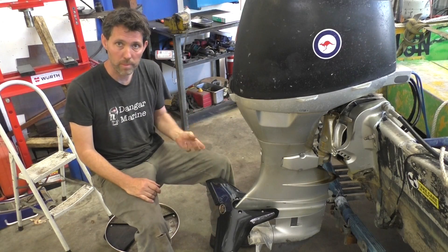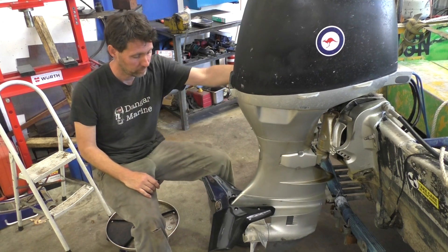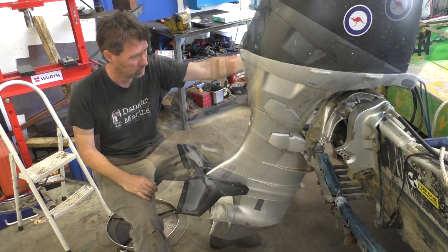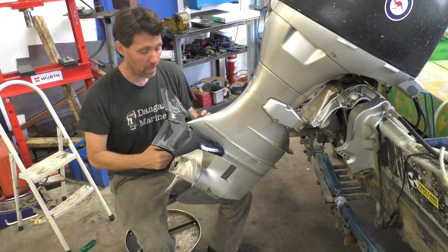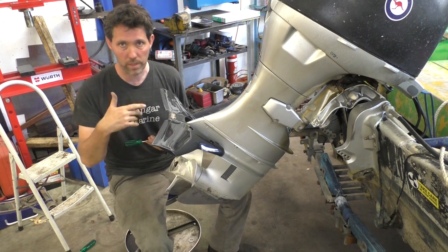Now I'm just going to trim the motor up to make it easier to get to the Phillips heads on the bolts from underneath. No huge trick to tighten them up, other than tighten them in a bit of a star pattern and don't over-tighten them — just let the nylocks do their job.